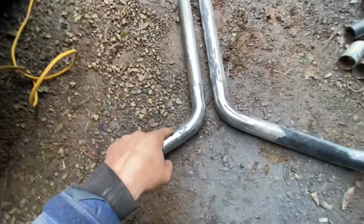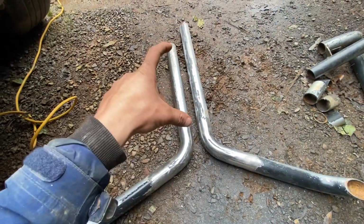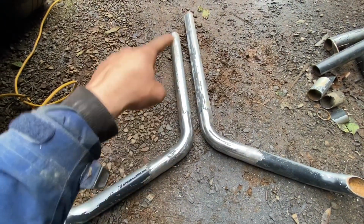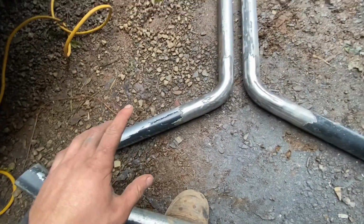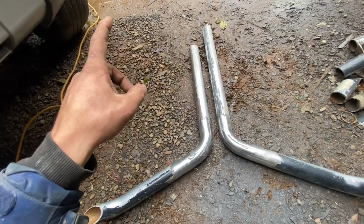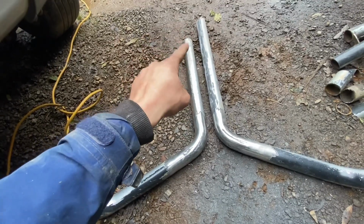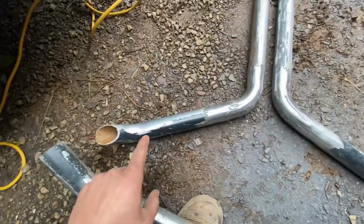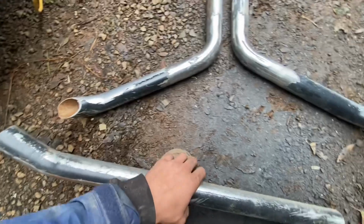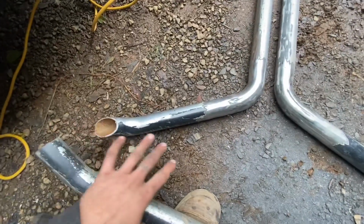So they're the two sides, and wired it up, and then I've just thrown a longer bit on there. That will be like the top bar, obviously. And I was just going to keep working around this way, but I'm actually going to start down here and work back up now, and then that joint will be the last one I weld up. I just think it's easier to get this and the next angle before I'm joining it.